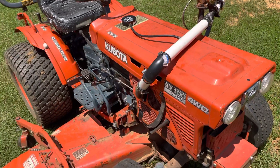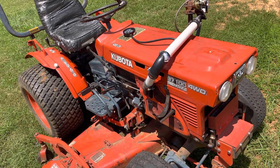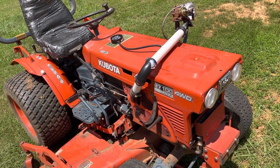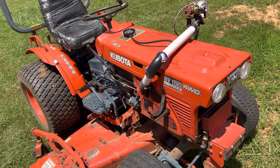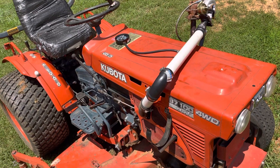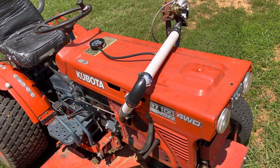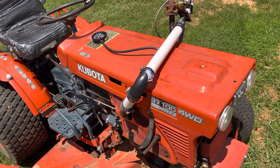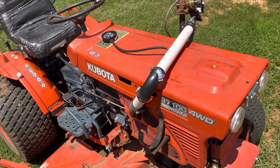I still need to get tires for this thing. Hope you guys have a good summer — it's hot, be safe out there, try to be nice to everybody. Hope this kind of helps. Once again, this is a 750cc Kubota diesel D750. The turbo is an RHV31 eBay knockoff, hitting roughly around three pounds of boost, three and a half pounds under load. Nothing special — injection pump is set stock, no timing advance.